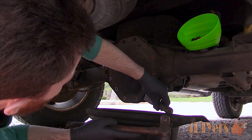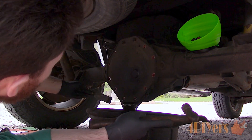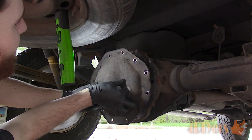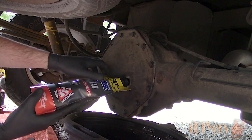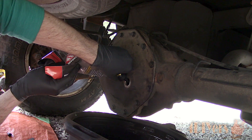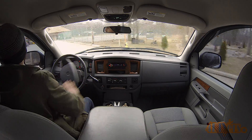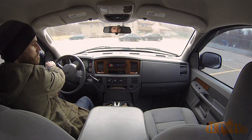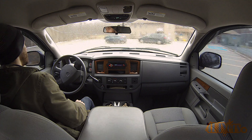As many of you know I did replace the oil on the differential a couple years ago. The differential didn't have the proper maintenance intervals for the oil and unfortunately that can shorten the life of the clutches. When I did replace the oil it helped, but a little while after it started chattering again. This is most noticeable when turning at low speeds or while taking off from a stop. Probably my driving style didn't help the already worn clutches either. After an oil change you'll need to drive the truck in a figure-8 pattern 10-12 times. This will allow the fluid to work its way around within the clutches and may solve the issue. If not, the clutches will require replacement.